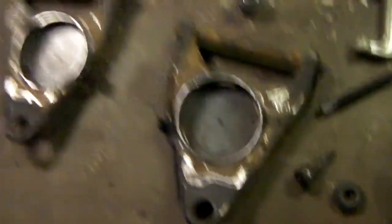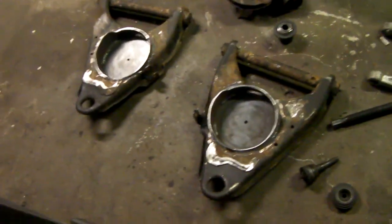Now all we've got to do is get some new ball joints and press them in. Thanks to Nick, we've got our lower ball joints pressed out. This one's freaking wasted. This is why you want to replace your ball joints after a period of time — they just get pretty much blown out and wasted. Had to order these because no one around here has them in stock, which is to be expected with this old C10.